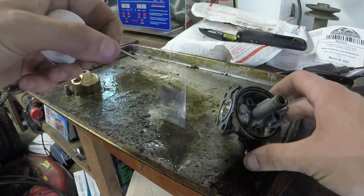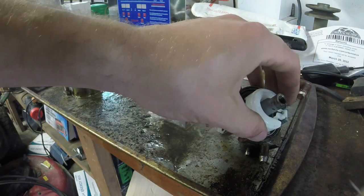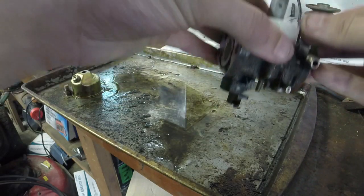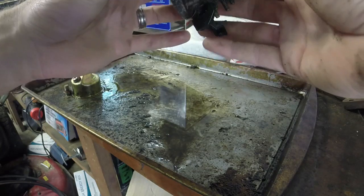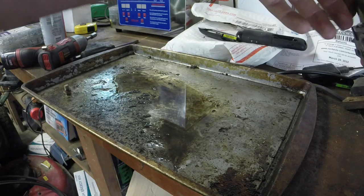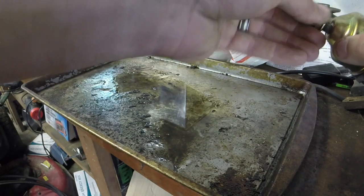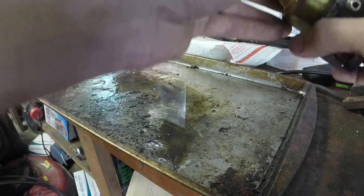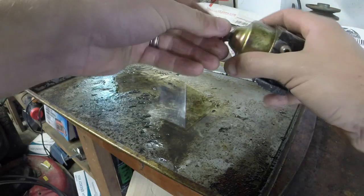The jet - this actually has a removable jet on it, that's good. The fun thing is when the jet doesn't want to come out. This is all it is - that jet needs to be cleaned out. Carb spray. The bowl's not even that bad. There we go, that's better. The other ports and passages - that should be good. Must have just been a little bit of debris. Let's put everything back on here - just a needle and a seat, and float. Because I know it is getting gas into the carburetor, which is a good thing. The bowl wasn't even dirty.